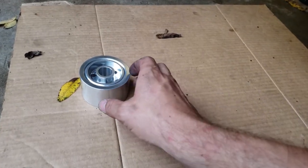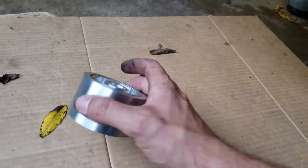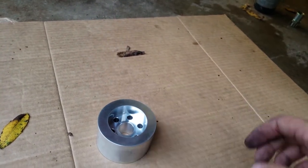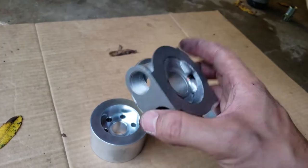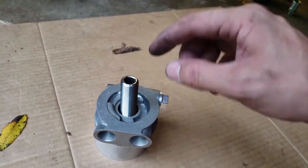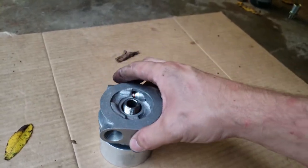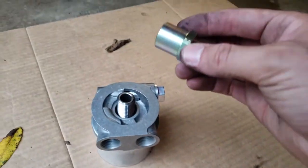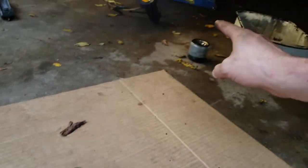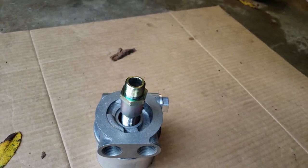In place of what used to just be an oil filter, we're now going to have this block — that's where the o-ring goes — and then the sandwich plate. This threaded rod is going to replace the existing rod on the engine. It also comes with this coupler that threads down there, so the oil filter can now seat on this surface instead of on the engine.